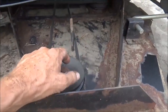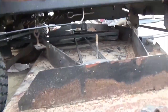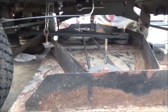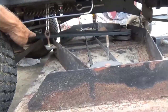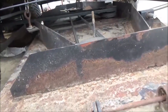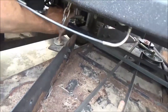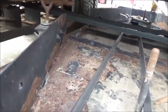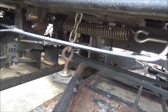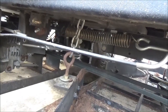I took the cover off on both sides, and I raised the deck up just enough so that the drive belt that has to come off would be level. If I push the arm down, the belt goes lower in the front, which makes it pull a little harder. I want to raise it up as high as I can and still have room to work. Yesterday I pushed the tension pulley by hand far enough that I think it went past a pivot point and stayed there, but I can't do it with the camera in my hand.